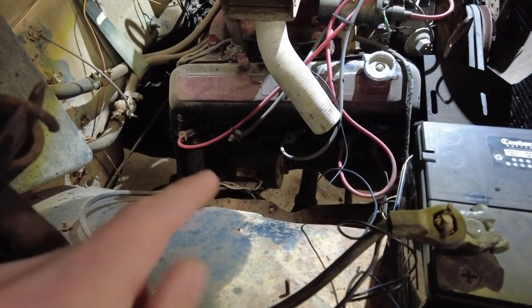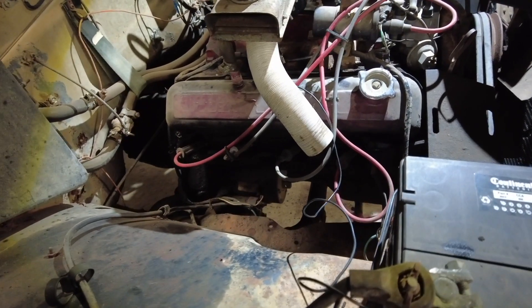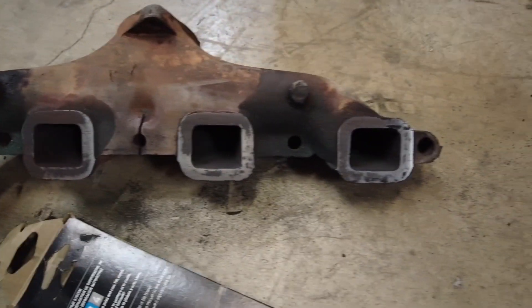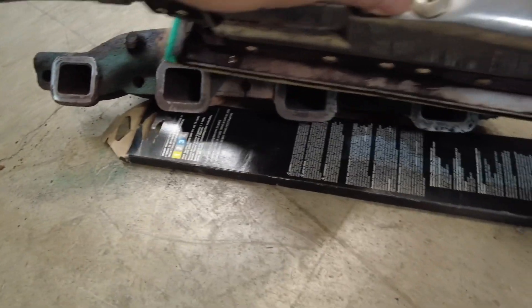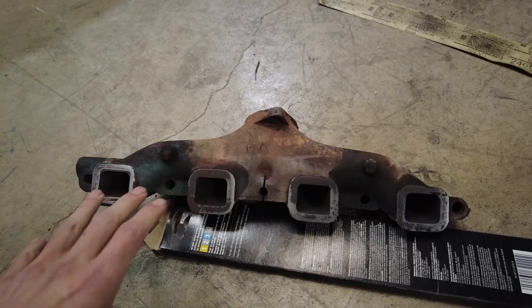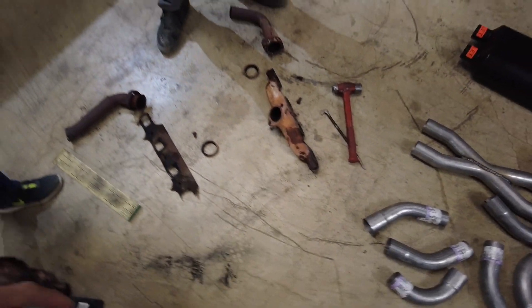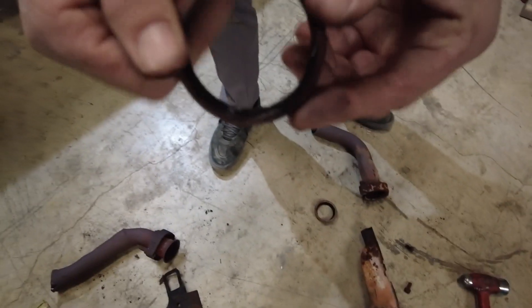Steven's got the manifold pulled off of this side because we didn't want to go this far without making sure that the exhaust manifolds came off and then we got them planed. Didn't break any bolts, right? No. So that's a plus, so we should be able to cover a pretty good amount of ground today without having to drill and pull bolts out of the cylinder heads — anyone who's done that knows how bad that sucks. These actually are in pretty good shape. Steven's been over here with the air file hitting them with 80-grit paper, and what he's doing is using this piece — it's like a big flat straight edge — and when you set that up on the manifold you can run that deal across and get one smooth even plane, and that's going to help you make sure that your new gaskets seal up really tight. Working on getting some of these donuts here; the guys at NAPA are bringing us some stuff down. One of the two donuts Steven said was good; this one here has been burned out, looks like charcoal almost. So we're gonna get some new ones of those — that's right where the collector goes together.